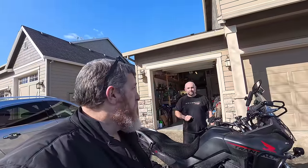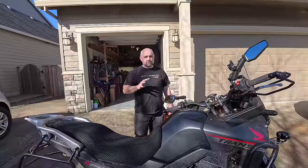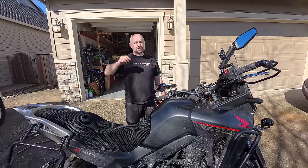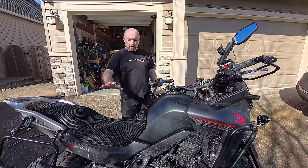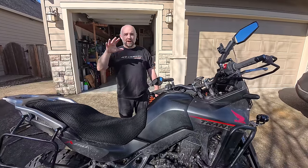So what improvements am I going to see when I go out and ride this thing? What is going to feel different? First and foremost, it's going to feel a little more plush while staying higher in the stroke. It's not just going to blow through the stroke, bottoming or feeling harsh. So the valving helps with the plushness and some of the dampening, while the heavier springs help hold up the bike and the rider.